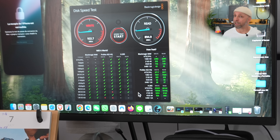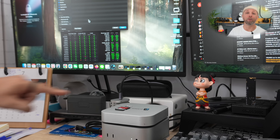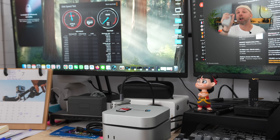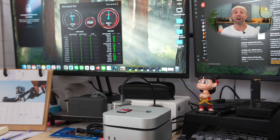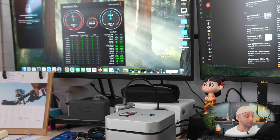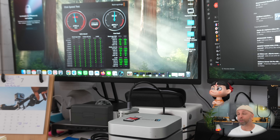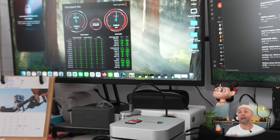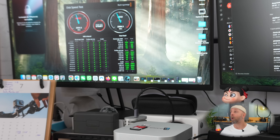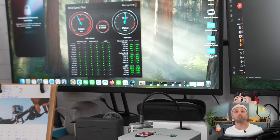900 and 900 with the front port — not bad, but plugging into the back Thunderbolt ports changes things significantly. At the back, despite the urban legend that the middle port with the lightning symbol is faster, apparently all three are equal. When connecting the external drive to a back port and running a test, we reach 2750 megabytes per second in writing and 3100 in reading — a bit more than the MacBook Air M2 results. Really reaching astronomical speeds.